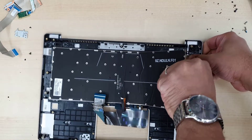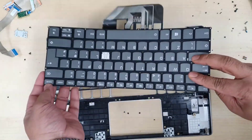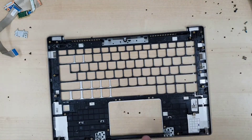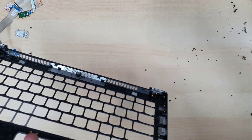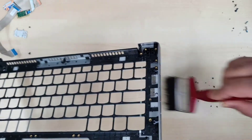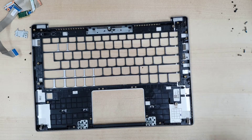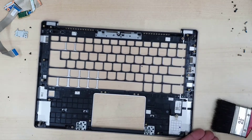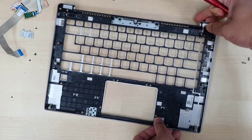Now it's pretty simple — we're going to put the new replacement keyboard in here. Before we put it on, we have to clean it a little bit because there are a lot of plastic bits and pieces. Then we need to put back every single component. Make sure you put the right screws into the right holes and connect every single flex connector properly, especially the LCD one. When you push back the hinges into place, make sure they are in the right alignment. That's pretty much all — let's carry on until we finish and then we'll test out the keyboard. Hopefully everything will be fine.